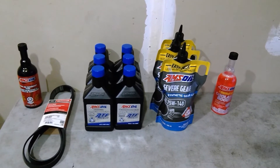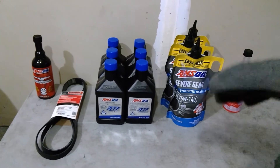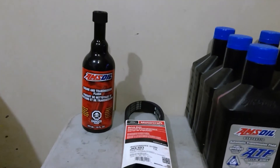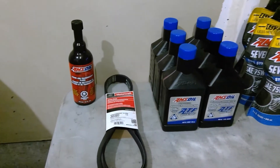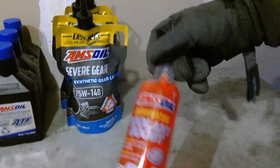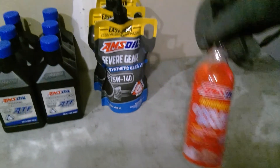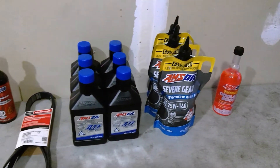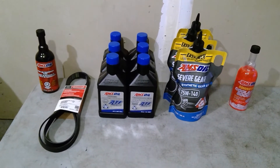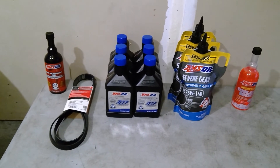Another due diligence you may want to do, since you're going to do an extended oil drain, is to do an engine flush. Go to your local parts store and get an engine flush. And since you're going to change your coolant, especially for those who race or are down south, get a Be Cool additive — Royal Purple and other companies make it too. I also like to change the lower or upper radiator hoses. I looked at mine and they're in great shape, so I'm not going to change them yet, but maybe in three to five years.